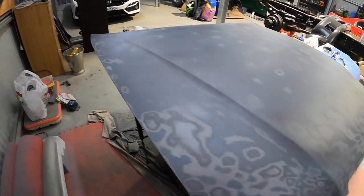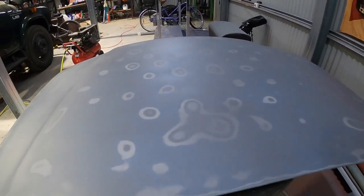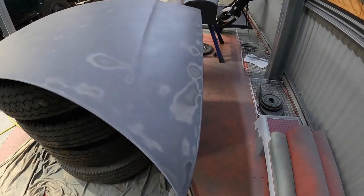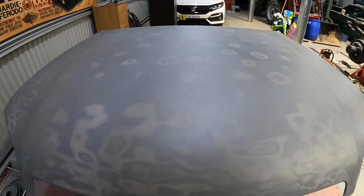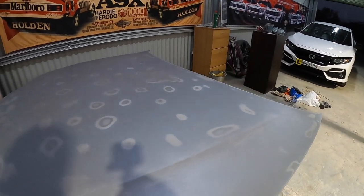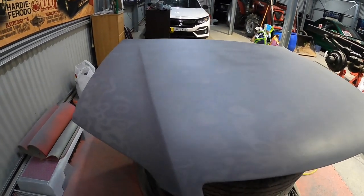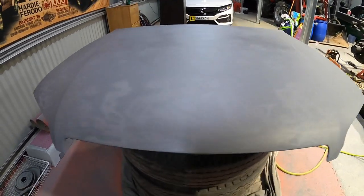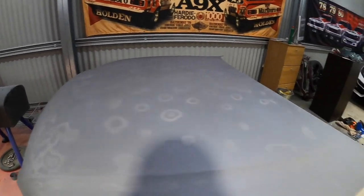The first coat of primer is on — a very light coat to start with, just to get it to bind to the metal. Wait 15 minutes and put the second coat on. When you're painting, particularly with etch primer, there's always a temptation to go a lot heavier and try to get it all thick — resist that temptation. Lots of light coats: first coat, leave 15 minutes, then the next coats 10 to 20 minutes apart. Let them dry because you can always put a heap of coats on, and we will be sanding this etch primer when done. Less is more.